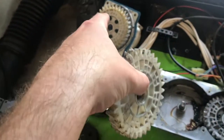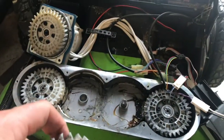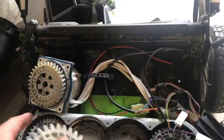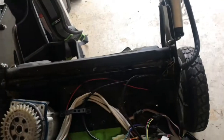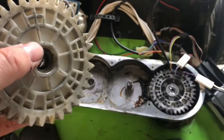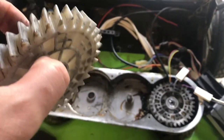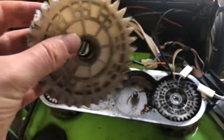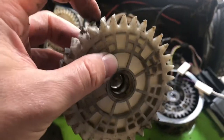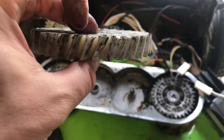You do need to pull the motor cap off to get the plastic cover off, and then you can get at the top cover — which is this thing right here — the top cover which the motor bolts into, and the gear is sitting inside of there, inside the top cover that it's bolted to. Hope that's an okay explanation. I didn't record it while it was taken apart, but I'll record it a little bit while I'm putting it back together. These lovely plastic gears are going to be your weak point when it comes to hitting something solid.